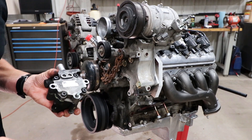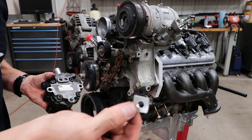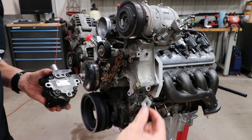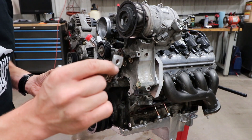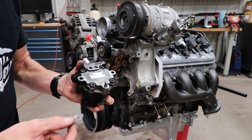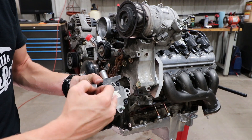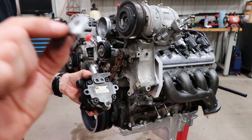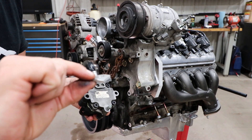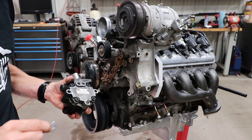What I did in the last video is I had this square aluminum spacer behind the entire Land Rover bracket — I thought it was just a washer. In reality, it needs to be in between the pump and the bracket. So we're going to correct that. I'll have to hammer this flat because I distorted it, then get it on the correct side.